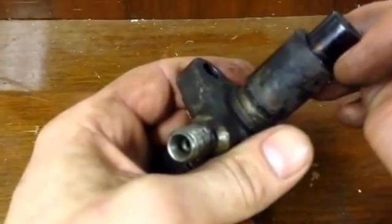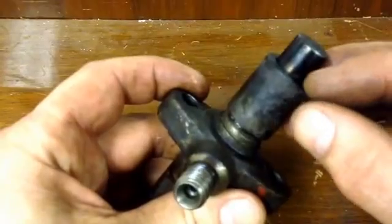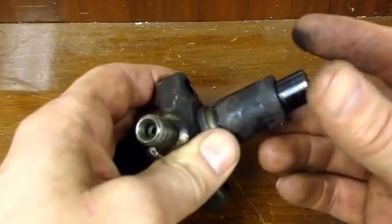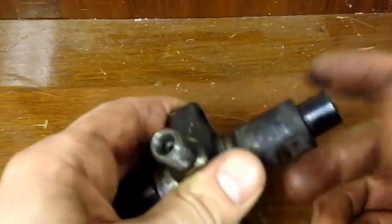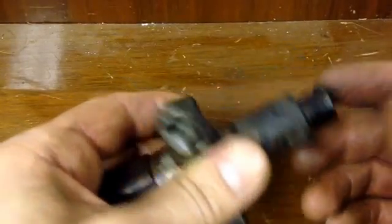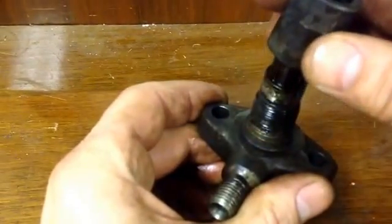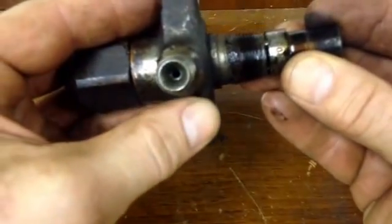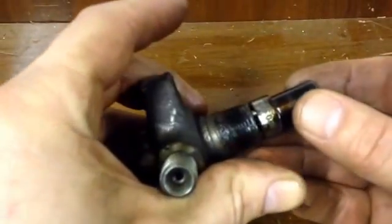Bear in mind this is your sealing face right here — that's where your copper washer goes. When you take the injector out you need to take your copper washers out as well. When you take a copper washer out you'll find it's got hard over time and it won't reseal properly. The trick is: get your washer, heat it stinkingly hot with a blow lamp, and drop it straight into some cold water. It's basically what you'd do to harden steel, but with copper it goes soft — pretty cool. Do that and they'll seat lovely.